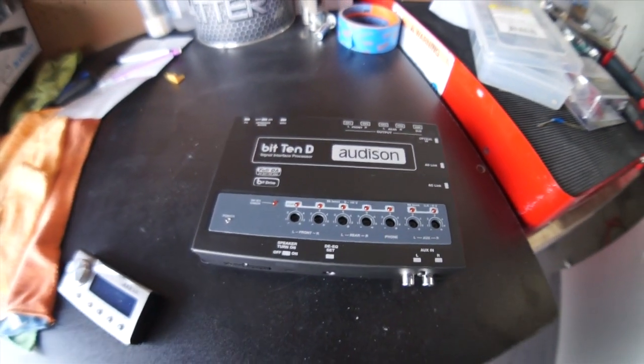He's also going to install an Audison audio processor, which will let us have full control of the audio system. We can set our own crossover points. We won't have wattage-robbing passive networks heating up and flopping around on the door panel. That's going to be a plus.